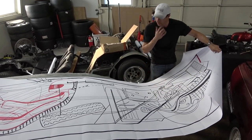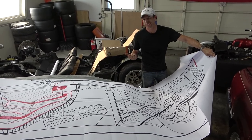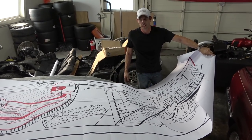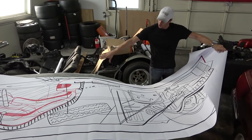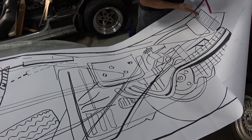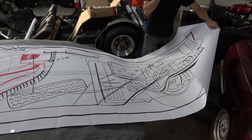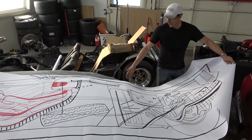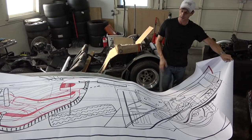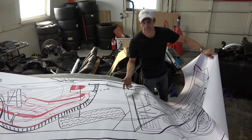The original car — I'm going to be honest — it was a beautiful styling exercise but it had a lot of problems. Two of which are driver visibility — that's a big problem — and the other is aerodynamics. This thing would be unstable at any higher speed because effectively it's an airplane wing that wants to take off. That big triangular opening at the top was oriented so that air was supposed to be drawn in through the top and go out the back, with the radiators in the back. That would work kind of well because of low pressure back there. But if you're drawing the air in from the top and going down, you're creating lift and turbulence.